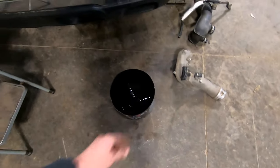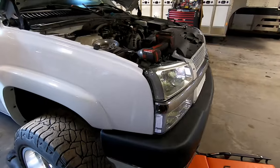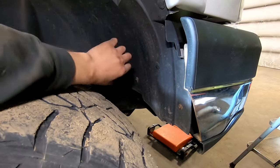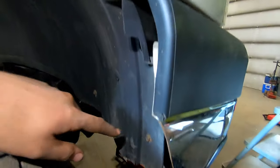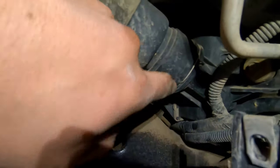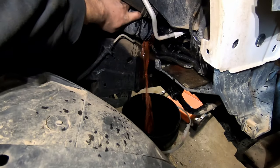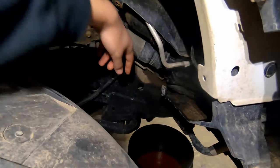Now we're going to grab a pail and start draining some coolant. We don't need to drain all of it, just a few liters so we don't leak a bunch when we take the EGR cooler out. For whatever reason GM got rid of a coolant drain on their rad, which is absolutely stupid, so we're going to pop this fender out. There's a coolant line that goes to the rad — pop the metal lock out, wiggle the hose back, put a pail underneath, and drain some coolant. Once it's drained, snap it back shut.